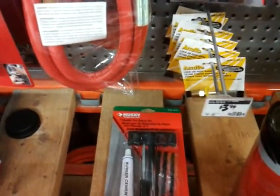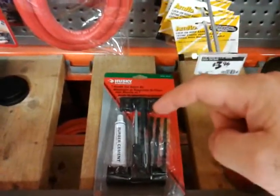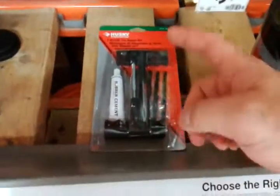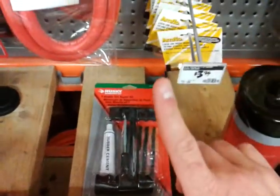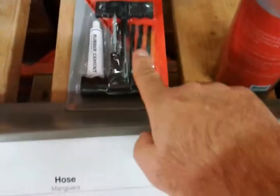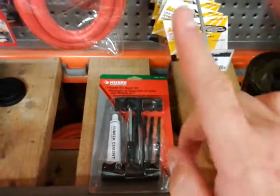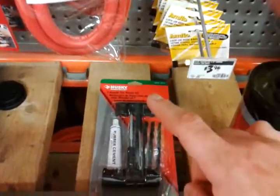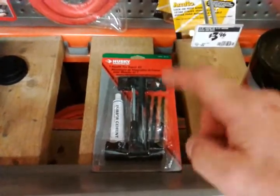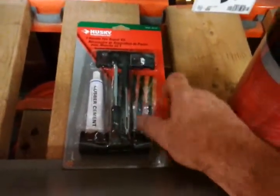The best way to fix these tires is dismount them, scuff up the inside, put a patch on the inside of the hole, or use what's known as a patch plug. And those are cool, man. It's basically the same thing as one of these guys with a wire leader. You string it up through the hole, you pull it out the tread, and then you have one of these going through the hole and a patch on the inside that plugs it all up and makes it not leak any longer. If you want to do it right, you got to break it down. You're going to put it on the inside of the tire for your best repair. But this will get you down the road.